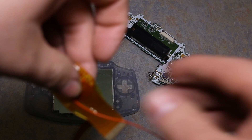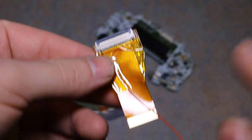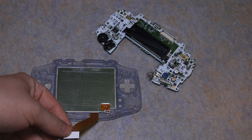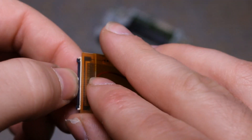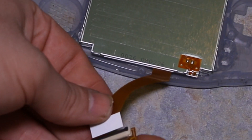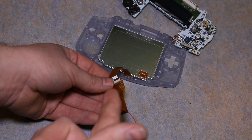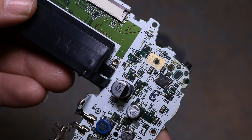You want to take your 32-pin ribbon adapter from Game Boy Advance SP to Game Boy Advance — this will come with the kit, and the kit will be in the description below. It took a little bit of finding out what to do, but I finally figured it out. You see this little black part right here — this is why long fingernails come in handy when you're modding. You just flip it back open, just like that. Now we can finally place this in here and close that. This wire right here has to be soldered onto the board of the system, somewhere around here — I'd have to look it up to be sure.